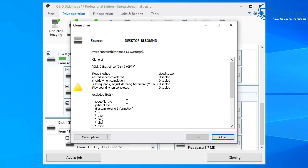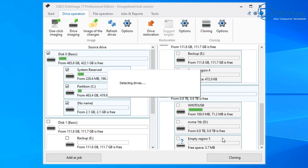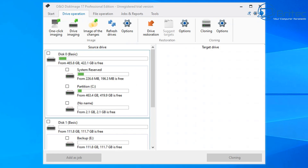It will start the cloning process and copy all of the information across. I'll speed this up — it didn't take too long and was a pretty painless operation. This software performed pretty well. There are a few warnings which give you information on what they are, but they haven't affected the clone at all. Next I'm going to boot to this drive to show you it's an exact copy, which means I can put it into my new PC.